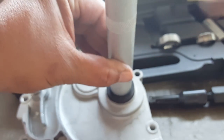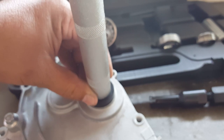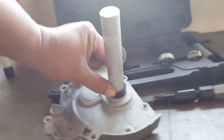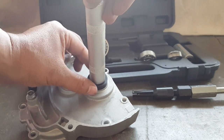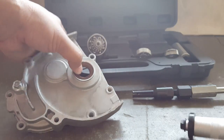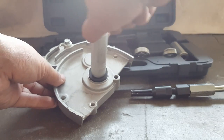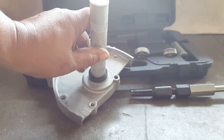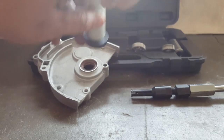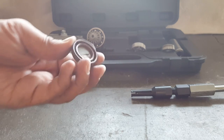We're going to go from this side — that way it protects the springs. You're going to take a mallet hammer and lay it on there, kind of flush it a little bit, and give it a little tap. I'm going to try to get the resolution a little bit better for you. We're going to go ahead and remove the seal. I'm trying to make sure it's not forcing it. It's coming off. You can see a little indentation. I'm going to keep on working at it — try to make sure we gap it evenly. Careful when you're working with aluminum — you don't want to put too much pressure on it. It's almost coming off, then just the other side. There we go — it just popped right off. That's the seal — you can see here it's not damaged.